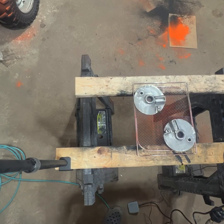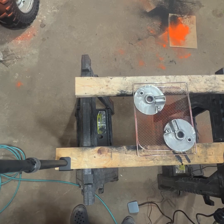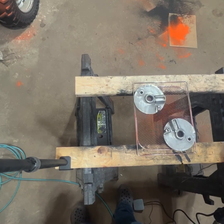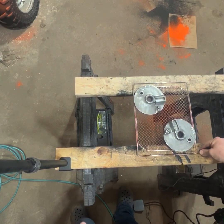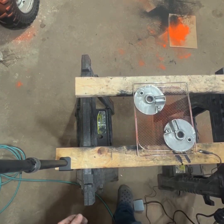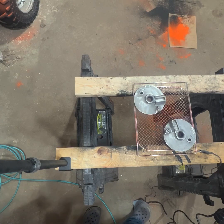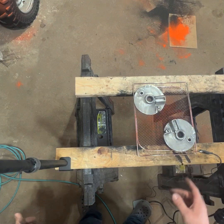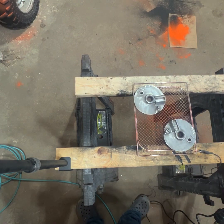So we just got our preheated pieces out of the oven here. They're nice and hot. So first thing we're going to do is hook this electrode up for the powder coater. We'll just hook it up to the rack here, and then it'll electrify both those pieces. Then for the powder coater, I just have a foot pedal on the ground that will supply the electrical current that'll go through the 2 pieces, and it should help the powder to adhere. So we'll see how it goes.